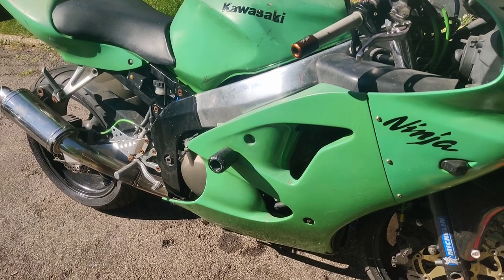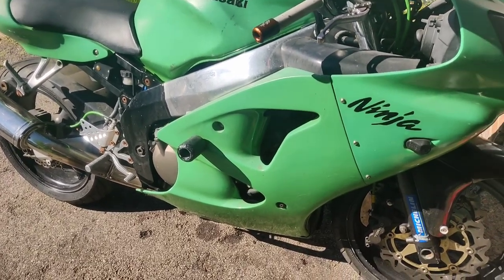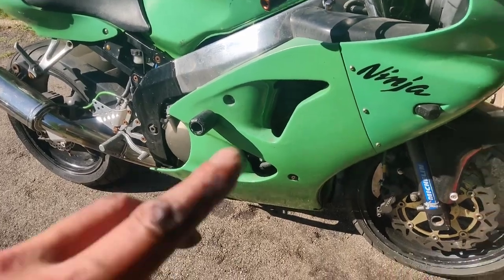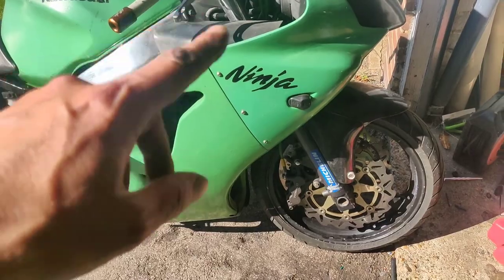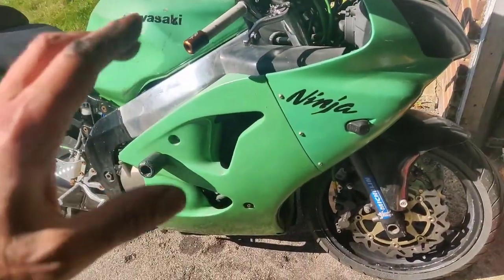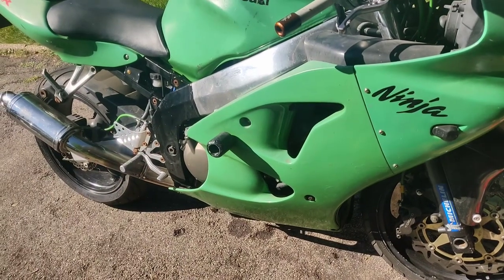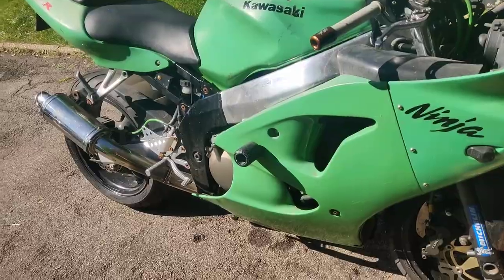Well chuffed. So what? It's going to be stripping it down now. Fairings are all going to have to come off, so I can actually get to stuff to start working on it. But I think in priority order it's going to be fork seals, brakes, all of which I could do with a fairing on, but it's easier off. And then beyond that is start digging through the electrics as much as anything else to try and coax that left side indicator back into life.